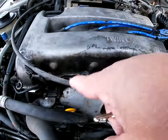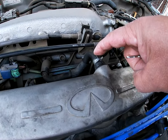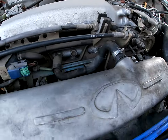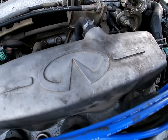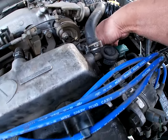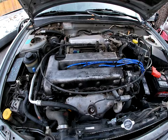Lo and behold, looking around I see the valve cover bolts missing. This hose was way back there hiding — a big old vacuum leak. Whoever was working on this thing did not know what they were doing, sorry. So it runs good right now.